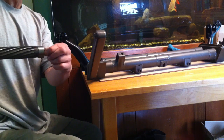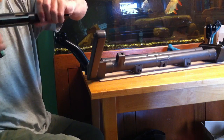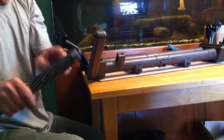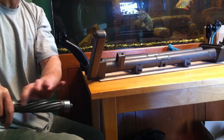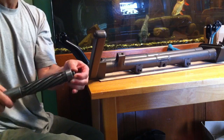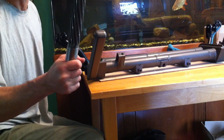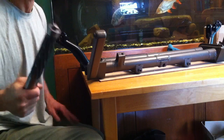It's called an expansion reamer — it's not adjustable. The adjustable one has you change the size by moving two screws. The expansion reamer expands by tightening a screw, and the intention is to expand it only very slightly so that each time you sharpen it you can keep the same size. What I used it for was to take a one-and-seven-sixteenths reamer and turn it into a 37-millimeter metric reamer for my beam. I don't think that's the recommended actual use for this tool because it goes beyond the maximum expansion, but I did it anyway and it works great.